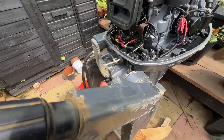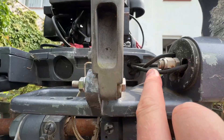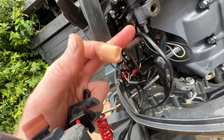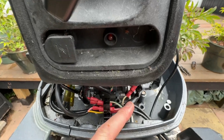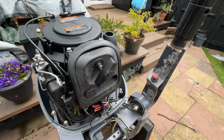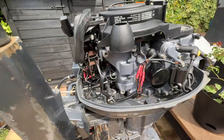So we need to get a new kill switch, or disable it - and hopefully fingers crossed that might be what it is. It's not too much of a job, just got to get that out and a new one wired in. It routes down to this area here, goes through here into the engine. This one here goes into this thing - that's the kill switch - and then into the engine. I need to get the multimeter out and do a bit of diagnosis on the kill switch. If your kill switch is stuck in the off position, it's going to be shutting down your motor.